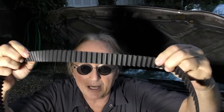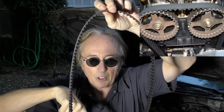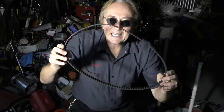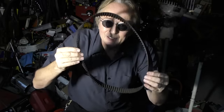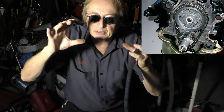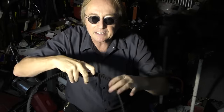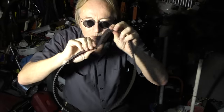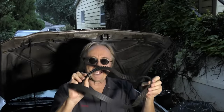So then came the idea of the timing belt. Instead of a timing chain, the pulley on the bottom of the crank and the pulley on the camshaft were connected using a rubber-based timing belt. And contrary to what people might try to tell you, the only reason it went to timing belts is because it's cheaper to make them. When you have a sprocket that uses a timing chain it has to be really strong steel, but the sprockets that run these rubber-based timing belts can be a lot softer because they're just pulling rubber, not steel. So most manufacturers switched over to timing belts.